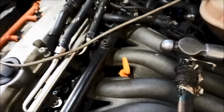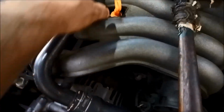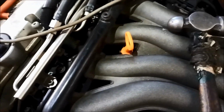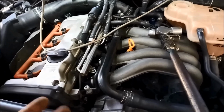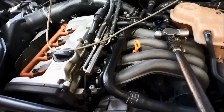That's actually a bleeder. You've got to have the thermostat, which is under here, under the manifold, open up, and you shouldn't be getting any air bubbles out of there. It should be just a stream of coolant. What happens if you don't bleed it, you'll get an airlock in the top half of the motor, and steam can get hotter than water, so you end up doing a head gasket. And that's an Allen key, 5mm.